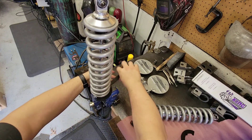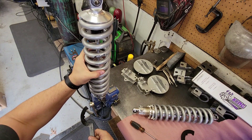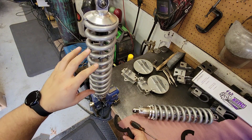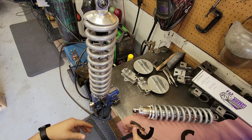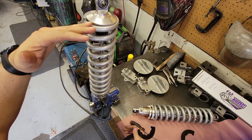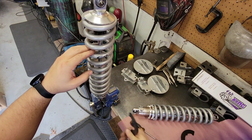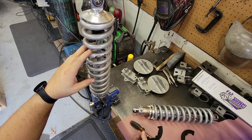You simply spin it until you take up all the slack. When the spring is snug against the top and snug against the bottom, this is zero preload — there's no additional force on the coilover. When you do add preload, you're adding force to the whole assembly before it starts compressing. For instance, if you have 500-pound springs and you preload it two inches, it's going to take a thousand pounds before this thing starts to compress, which raises your static ride height. You don't want to do too much of that because you still want the shock to ride in the middle of its travel where you made those marks on the shaft. If you have to add too much preload, that probably means you need a stiffer spring or a different size shock.